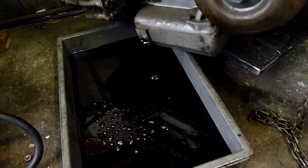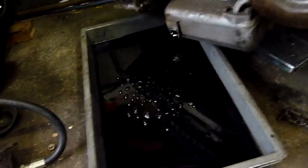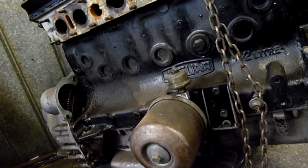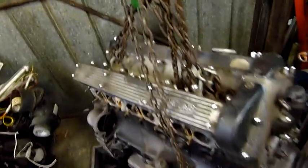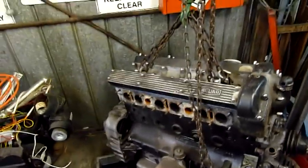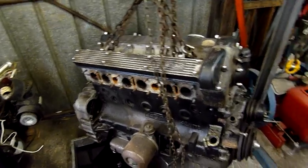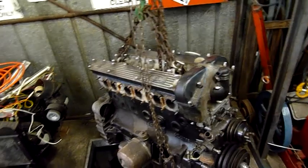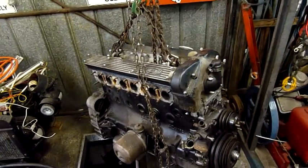These things hold about nine litres of oil normally. You can't fill this one up all the way because the blow-by has a tendency of pressurising the crankcase to the point where the PCV can't keep up, and it blows part of the oil out of the dipstick. It covers the firewall and the exhaust system and the whole underside of the car. That's why the Series 1 that I had was pretty much coated underneath with oil, because this is the engine that came out of it.